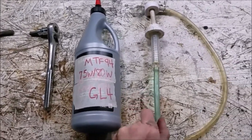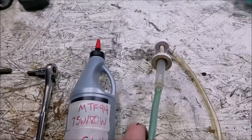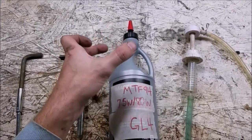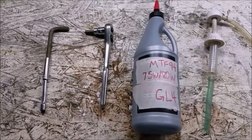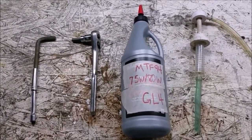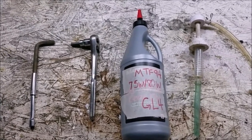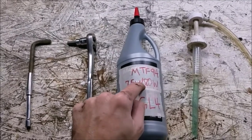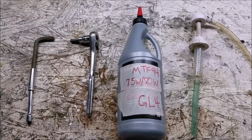You're also going to need a transfer pump. This one screws right on and has two different lid sizes, so it'll attach to this lid or another style if you've got a gallon size — you just pump it up. You should be able to do this in under half an hour, including jacking the car up and putting it back down. You're going to need two quarts because you need a quart and a half, giving you a little extra in case you spill or need to top it off in the future.